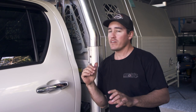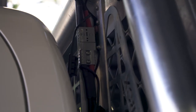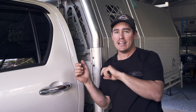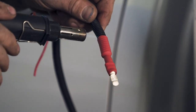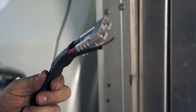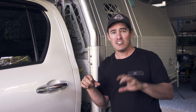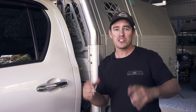One thing you'll notice about this 12-volt setup is we've used Anderson plugs to connect the wiring from the vehicle to the canopy. So if this guy ever wants to take his canopy off or his tray, he'll be able to do that by simply unplugging the Anderson plugs. Anderson plugs also have a really good connection. You should get into the habit of using Anderson plugs anywhere you can in a 12-volt system — not just on the main wires. I even like to cut off the cig socket on the back of the fridge and replace it with an Anderson plug, because even across corrugations and rough roads it will never slip. An Anderson plug has a great connection and is also rated for 50 amps, so no matter what size wires you're running through it, you know it's going to be up to the task.